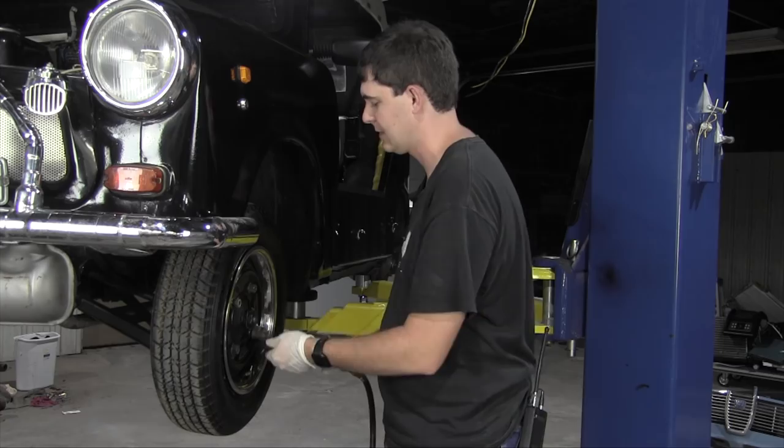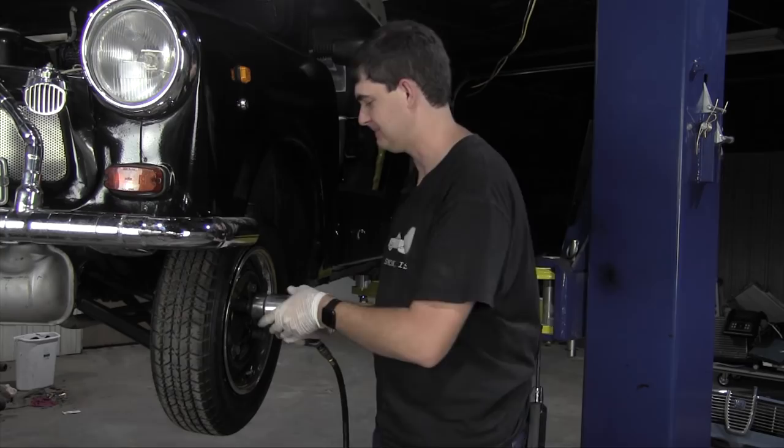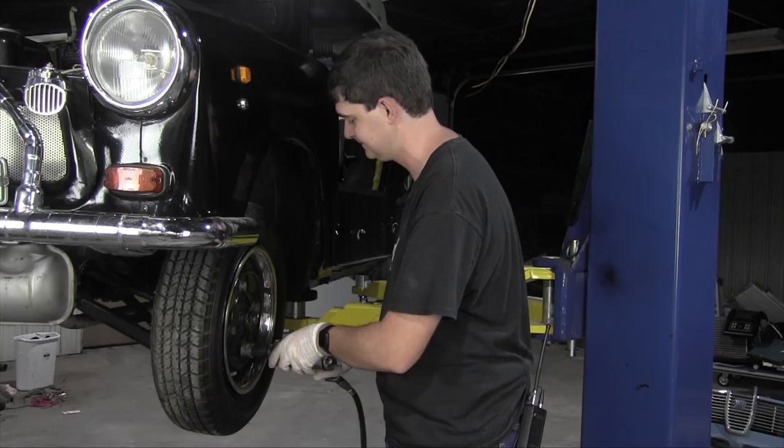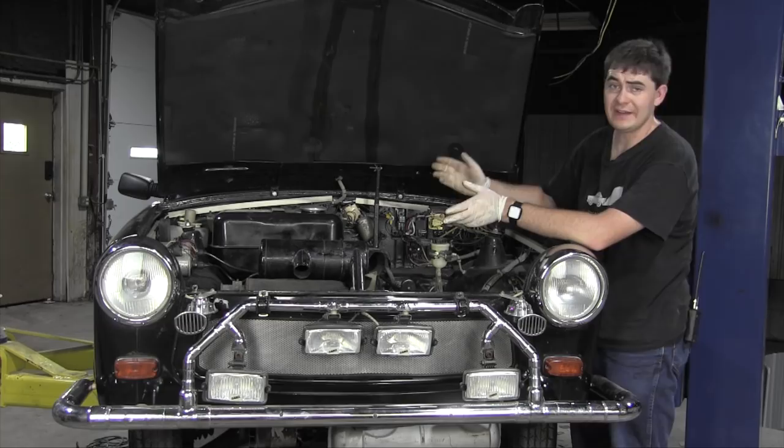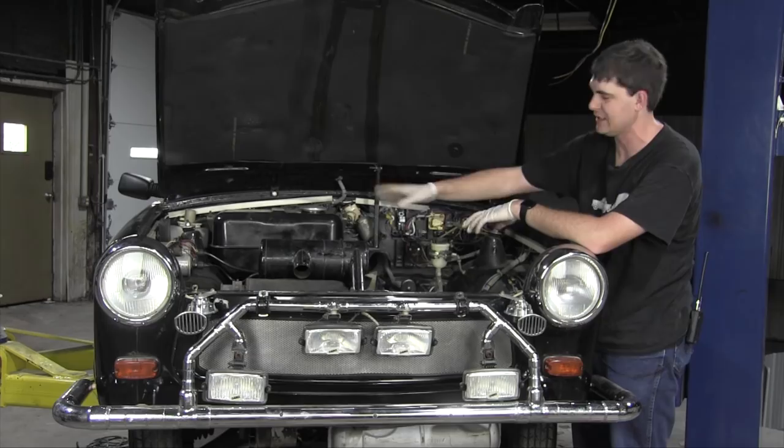But now the next step is to make the engine run again by replacing the fuel system. Visually interesting task. Getting this car to run will actually be pretty easy because it already runs. I poured gas directly into the carburetor intake earlier and it ran for a little bit, as long as there was gas in there. All I need to do is replace the fuel line and put the Trabant correct petcock on the bottom of the fuel tank, drain the old gas out, and it should start up just fine.